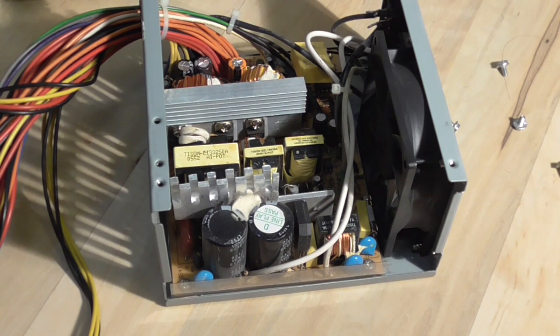This video is going to be on replacing a power supply in a desktop computer. This is the power supply that I took out of my PC. When you have a computer that is running fine and all of a sudden it just goes dead, the fan doesn't come on or the lights don't come on, there's a very good chance the power supply will be burned out. It's a very common thing.